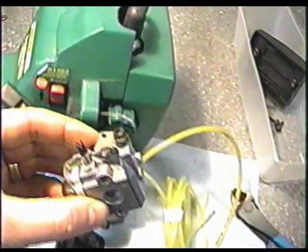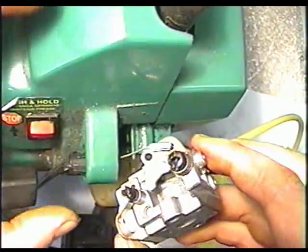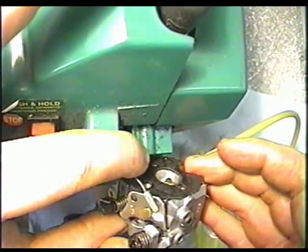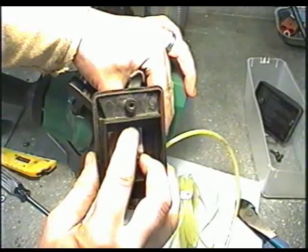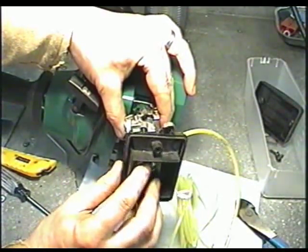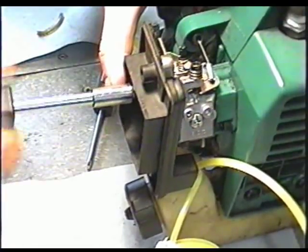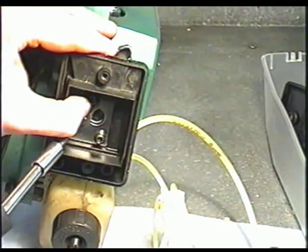The carb goes this way, in this position here. First of all, you want to put the throttle lever back on there. Line up the carburetor — put the holes here to the holes there, and make sure your gasket is on properly. Now you need the carburetor cover, which also holds the air filter, and the two screws like that. Put them in and get them started. Don't tighten the two bolts too much because you're just screwing them into plastic.